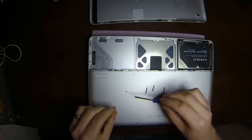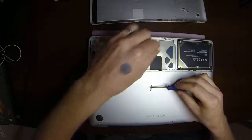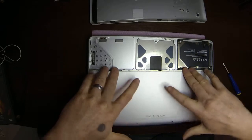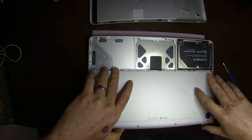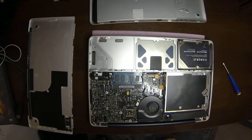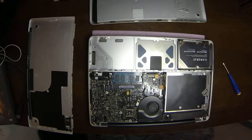I'm going to go ahead and put all these screws back here out of the way. Now this little panel right here — you can use your thumbs and grab at the back edge where the LCD hinge is and pull it right off like so. Pretty simple. This is one of the easier Macs to get into just because it has the removable tray which gives easy access to the hard drive.